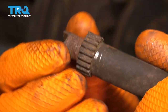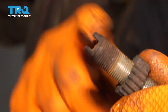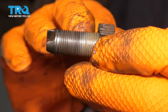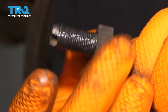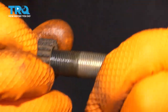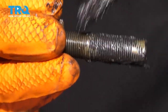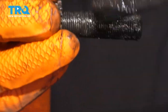And this is good to reinstall. One last thing I want to clean up is this adjuster. The threads look perfect — I'm not going to do anything to them — but I will take this little star wheel off, unthread it, and clean up these threads so I can put some grease on them. Bring this to the wire wheel and clean it up. Apply a little bit of grease — if you put too much, the adjuster wheel will just wipe it all off, so there's no way to actually overdo it. Once I coat the threads, I'll drive the wheel all the way to one side, apply grease to the rest of the threads, and push it back to the other side to work the grease in. Wipe off any excess grease, apply it to the other side as well — the wheel most likely won't make it all the way back because there's so much adjustment; if it does, your shoes are probably completely gone. Just put a little bit there so it has some reserve of grease.